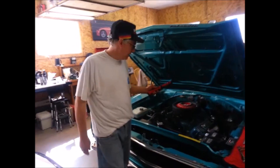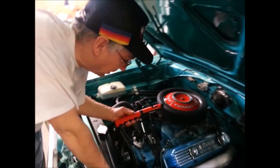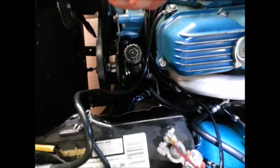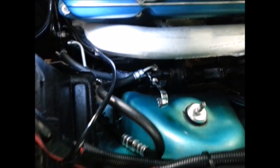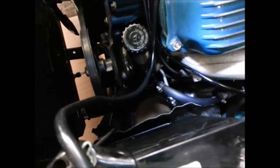The hose is on. My wife helped me a little bit and she also took some pictures we'll upload to the website. You can see down there the hose kind of loops around. I looped it around a little bit differently because the hose is not a direct factory replacement. I also replaced the return hose here with a new one — it's just a 3/8th line for power steering.